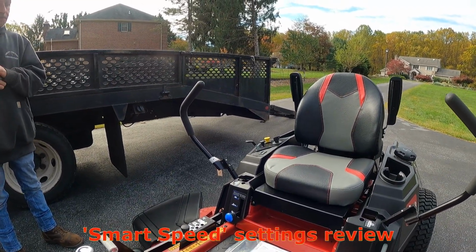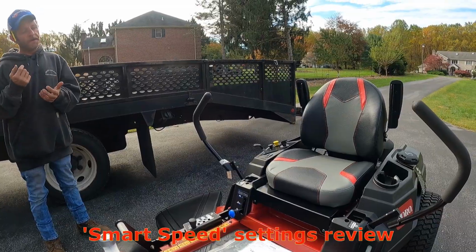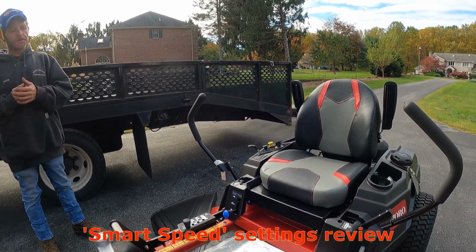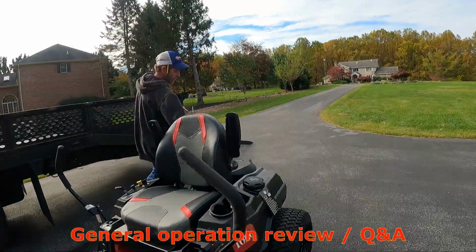Okay. So just be mindful that it is a machine. Don't have your fingers underneath of it when it's running, but try to keep it clean. If you're going to wash it, have the engine running so that it doesn't short circuit the coils and give you a misfire or anything like that. Don't focus around the flywheel, around the carburetor area.